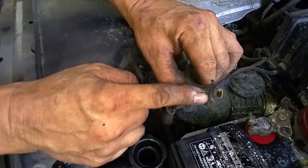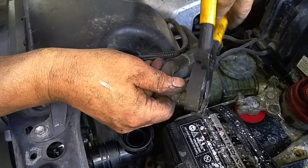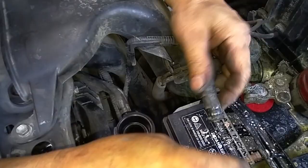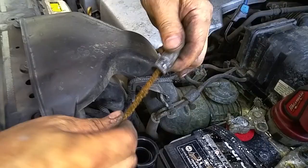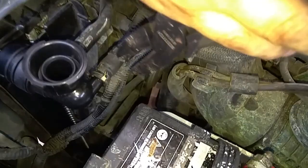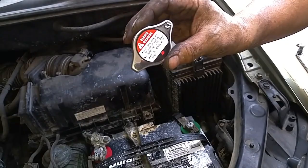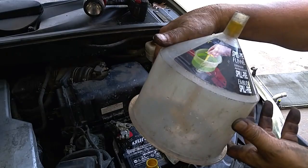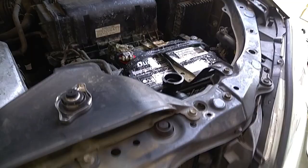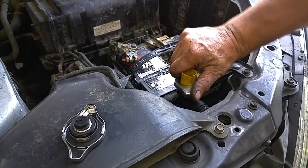The plastic piece — the remnants from the old radiator — is broken in here, so I'll move this clip over and secure it. The new radiator didn't come with a new cap, so I had to go buy one. This is my spill-free coolant funnel that comes with various adapters. The advantage of this is I can have it partially filled with coolant, and when I start the engine, as the air bubbles come up, the coolant won't be spilling all over the place.